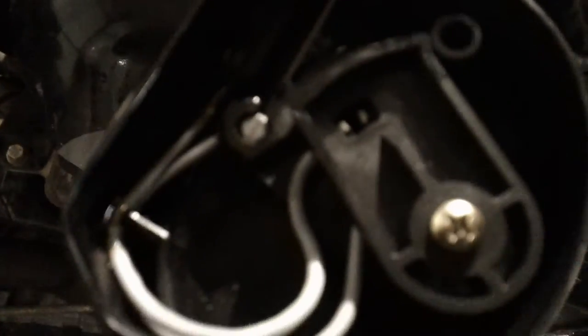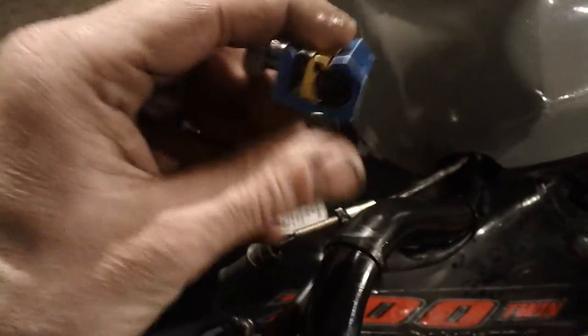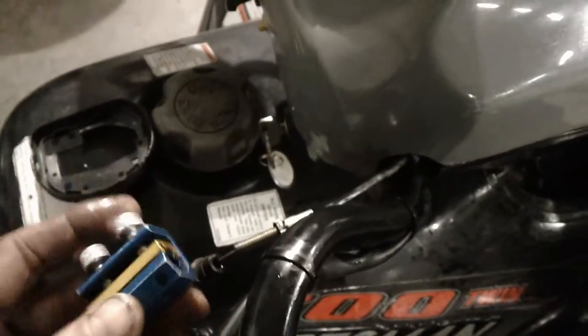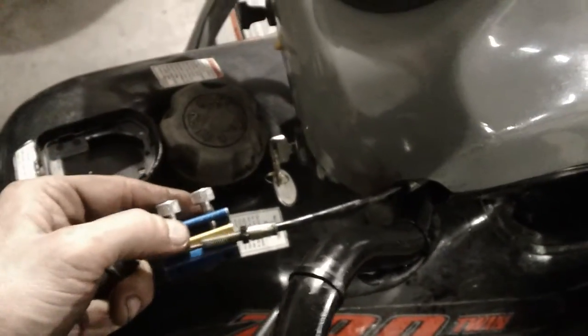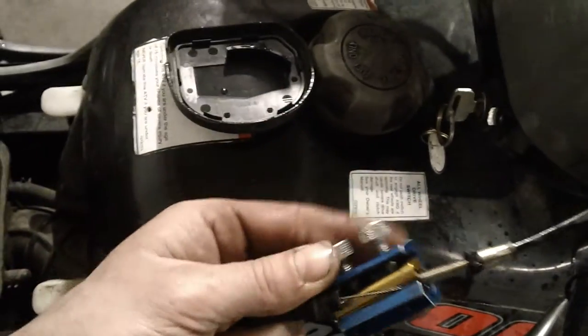Then you'll have something like this. You grab the cable oiler tool and clamp it on there. There's a groove down the middle — a slot. That boot inside there is all enclosed, with the exception of the slot going to the end, going right into the halfway into the center. So the stranded, braided cable in the center — the actual cable — you've got to stick into that slot, and you put the outer housing in as well.